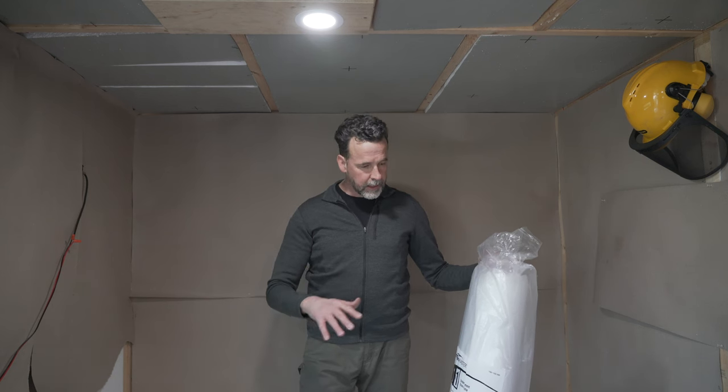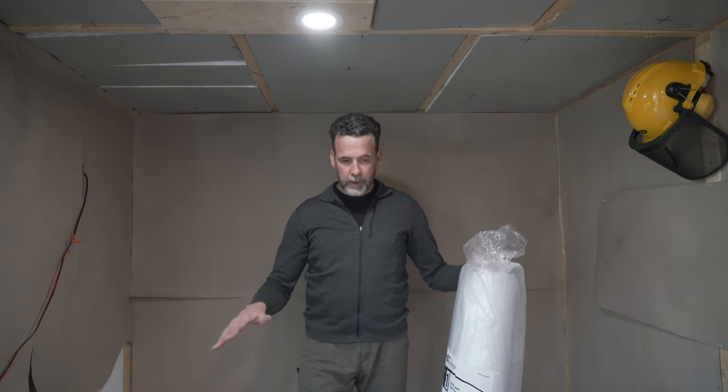I've put a layer of vapor barrier over top of the flooring and did my best to tuck it over top of the wheel wells. The main reason I did this was in case my water tank or some other liquid container leaks over the years and I don't know about it — this will prevent water from dripping and saturating the plywood. I've done my best to make sure the three-quarter-inch plywood does not get wet and rot, insulating it underneath with aluminum and eventually foam insulation, and now with this vapor barrier over top.